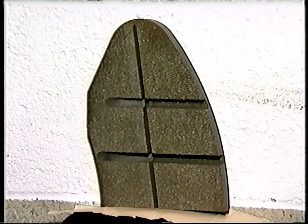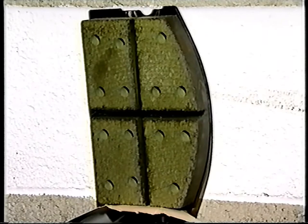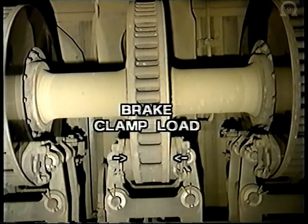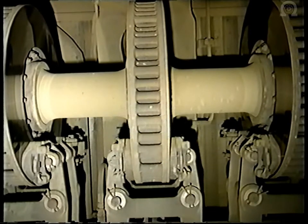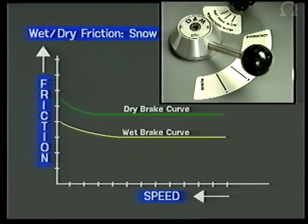Let's take a closer look at the brake pad. The friction material must meet the stringent BR569 specification, giving an acceptable retardation performance without causing excessive wear. All friction materials are service tested for a period of 12 to 18 months. The shape of the friction material is critical as well as the groove pattern. These groove patterns may be likened to the tread pattern of a car tyre — they serve to make the friction pad flexible enough to ensure total contact with the disc and to dissipate any water from the disc surface. The force with which the pad is applied to the disc is called the brake clamp load, and this load is vital to the clearance of water between disc and pad. The specification for friction material also incorporates a dry to wet frictional relationship. We can see from the graphic how the gap between the lower wet friction curve and the upper dry friction curve narrows as the brake clamp load is increased.